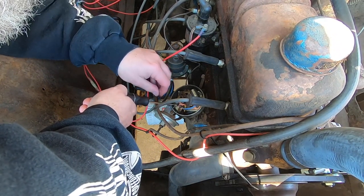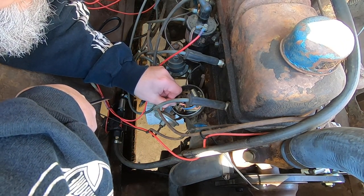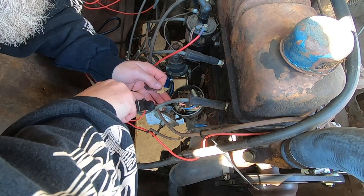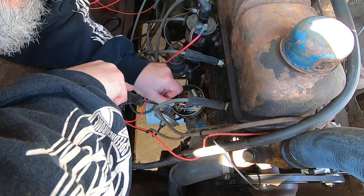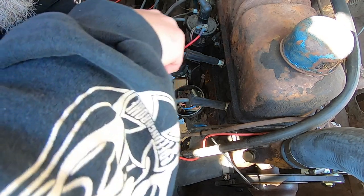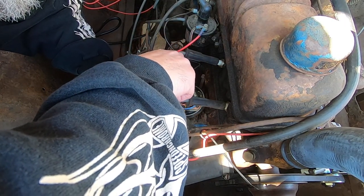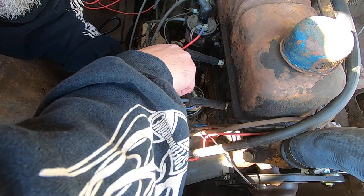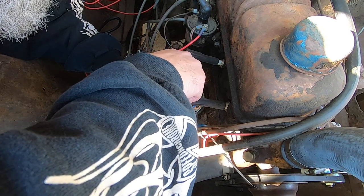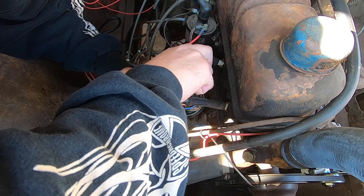I'm playing this at regular speed too. A lot of the other videos I have on here, I speed up because you don't need to see it in real time. But this I'm playing at actual speed just to show how you can go in and make a fine adjustment, check it, make another fine adjustment, check it, so it's exactly where it needs to be. This one, every time you went to tighten the points so they wouldn't move, it kept readjusting the gap. So it took a little bit of time to get it just right.